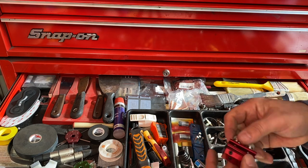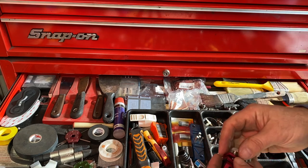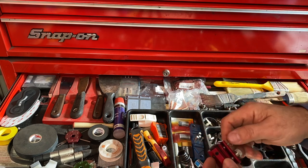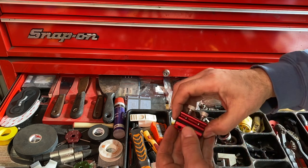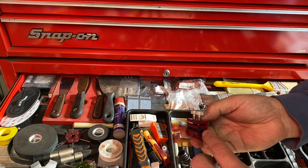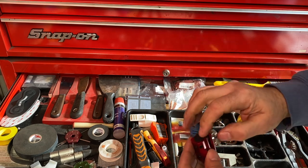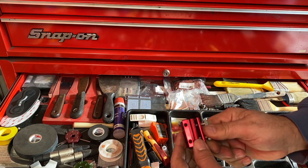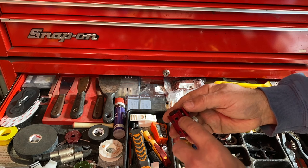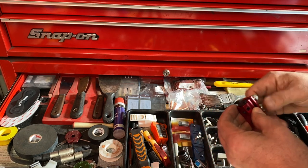This is a neat little thing to lubricate brake levers and that sort of stuff. You have a wire inside a housing but you need to lubricate that wire inside. This slips over — you open that up like so, slide that over the wire, and this has got a split in here with a hole there. So you slide that in over your housing, close that up so the rubber grips around the housing. It's nice and tight, and then you take your spray into that hole and just spray it, and that goes down the housing into whatever you're trying to lubricate. Works a treat — I use that a lot.